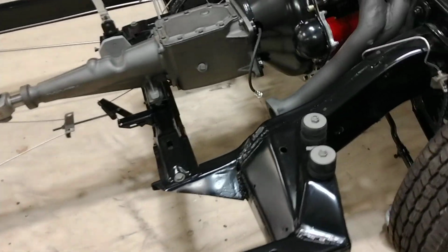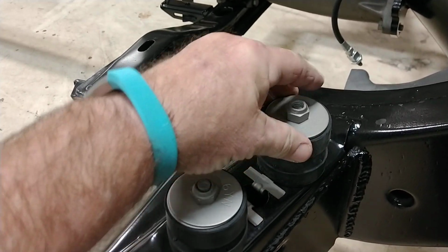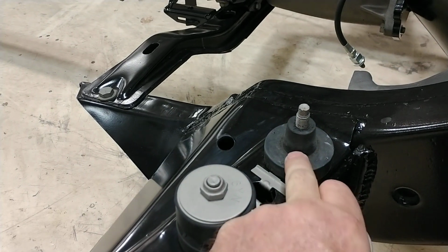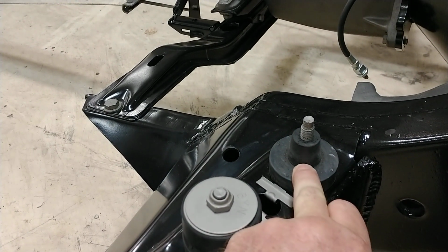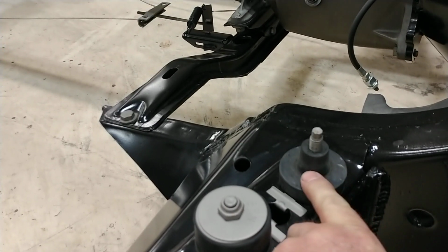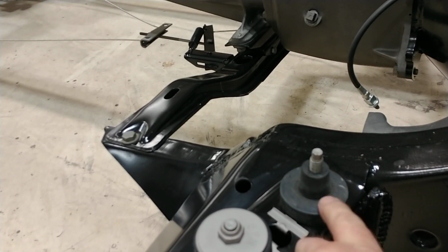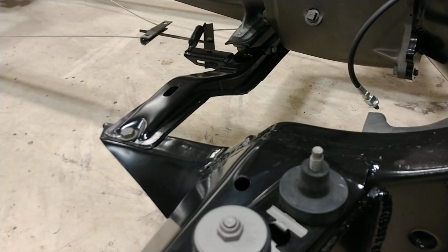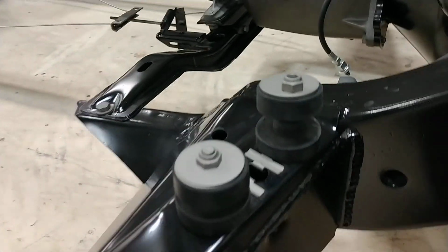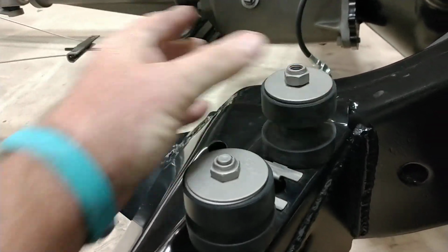The one up here was a little more difficult to make. You can't buy exact pieces for this. So what I did was put the bottom one on as a generic. It's got a 1/2-inch air hose as a filler piece. And actually that piece right there is a rubber cork from a hardware store like Ace Hardware. I drilled it out for the appropriate size. Matches the original mount exactly. I was kind of surprised. So that was probably the hardest thing to figure out. After you get to thinking about it, it all worked out.